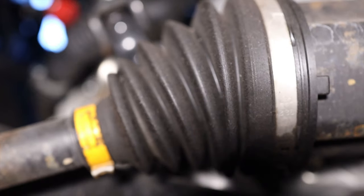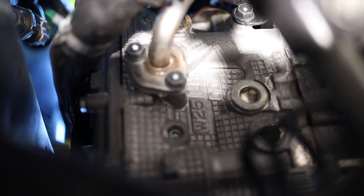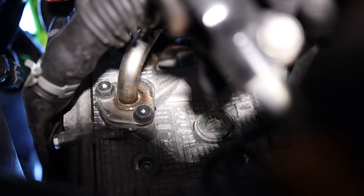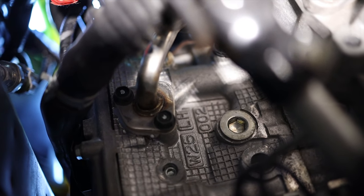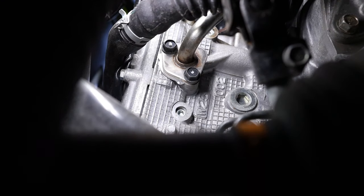For reference, the left axle is right here — past the axle, on the back of the engine, you'll see a hex-looking bolt. That is the bolt you want to remove. It's very hard to film but my finger is pointing right at it. You'll need a 12mm hex key. A normal ratchet isn't going to cut it — you'll need to get a breaker bar.